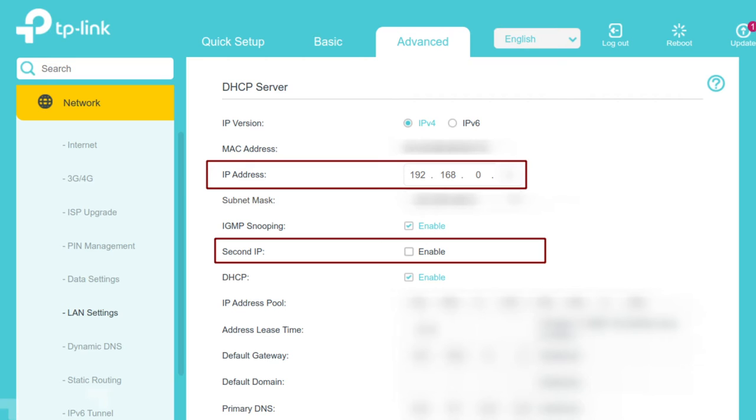It took me a few hours to figure out all these steps, but hopefully that saves you some time. In summary, you wire your ISP router into the WAN port of the TP-Link cellular router. There is a SIM card in there and cellular antennas, so now there's 4G and ISP coming into the TP-Link. The TP-Link is in the operation mode of wireless router, meaning it primarily acts as a router for the ISP connection, but because it has that 4G infrastructure built in, it's able to automatically back up to cellular in the event the primary drops.